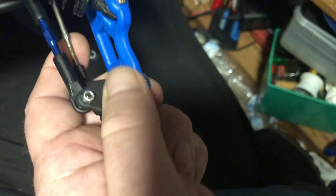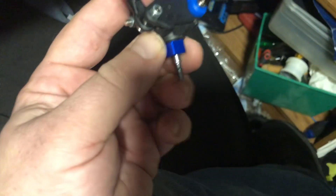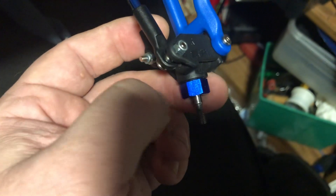The caster and camber block is a common breakage point — it'll break right down the middle. I had that happen on a Rustler years ago, broke right there. My recommendation is: anything that has a bearing in it is probably a good idea to go aluminum.